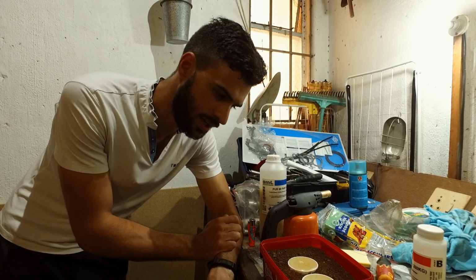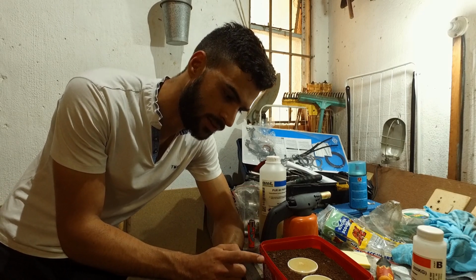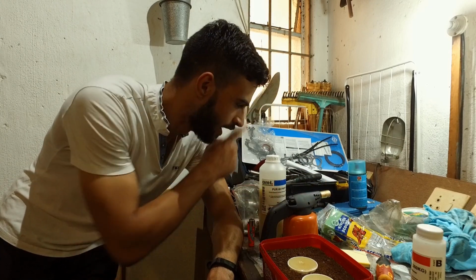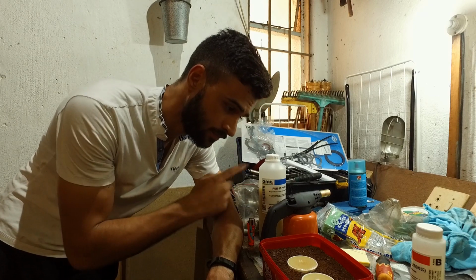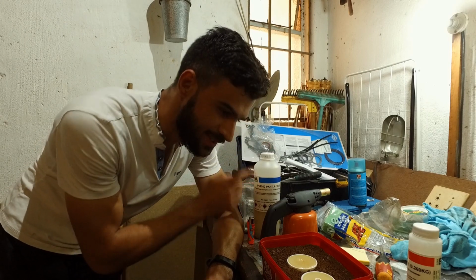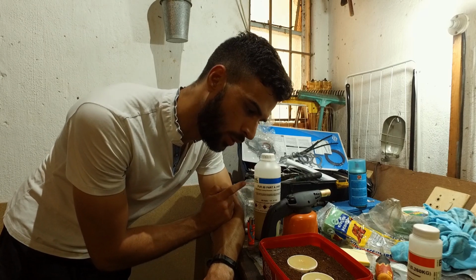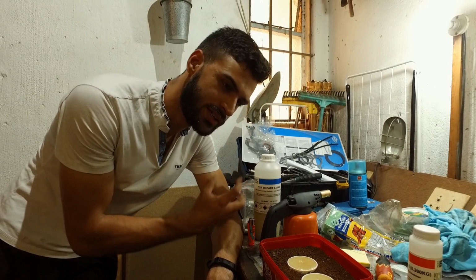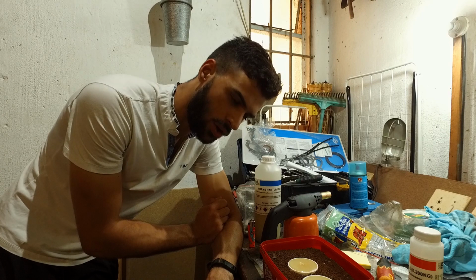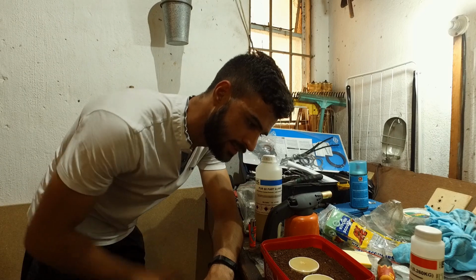In that other time lapse I showed you guys, basically we did the calculation to check what the volume of each of these would be. I then went and did the ratio of 100 to 26. As you saw, I had to use YouTube as my teacher. So we did the ratio of 100 to 26, mixing ratio of part A to part B. This is a PUR60, so it's a 60A on the Shore hardness scale. So these, the hardness is actually meant for engine mounts. So let's see how it is. Apparently it's just slightly harder than stock rubbers, but we'll see when they set.